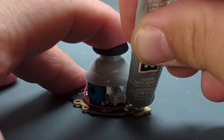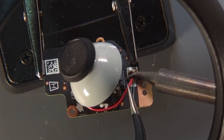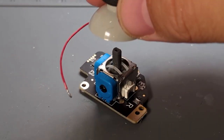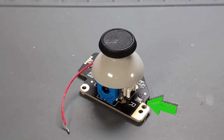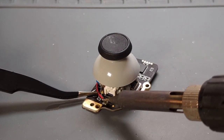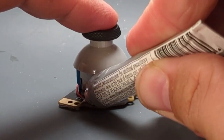Add hot glue or E6000 to the soldered area to protect against wire stress and oxidation. Let the glue dry thoroughly. On the second stick, burn off the glue and melt the solder to remove the capacitive wire. Remove the cap and press it on to make sure it seats properly. The exposed end of the wire will touch the solder pad by the letter marker — add flux and solder the capacitive wire to the pad, then clean the area with IPA.